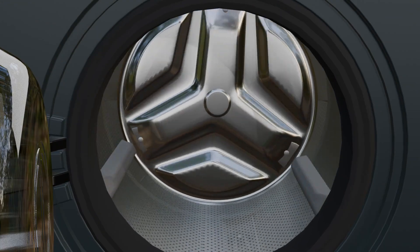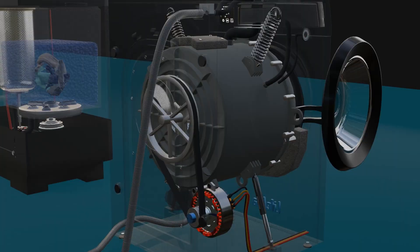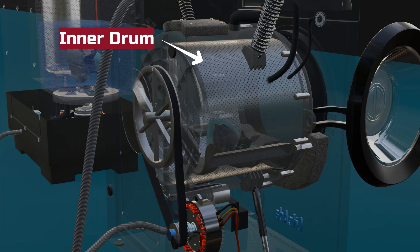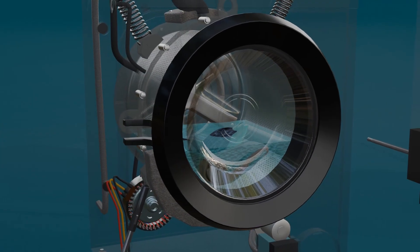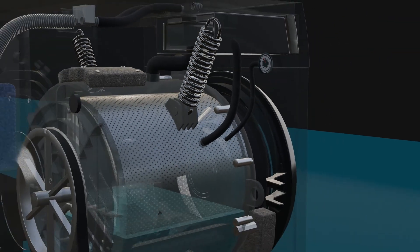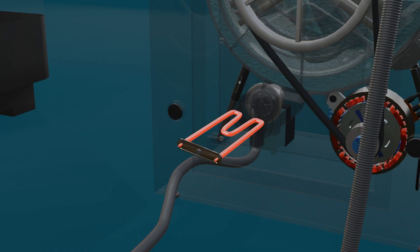In contrast, a front-load washing machine features a drum that rotates horizontally, powered by a motor mounted at the rear and connected via a pulley system. In fact, a front-load machine has two drums. The outer drum is fixed and holds water; however, water only enters it after clothes are placed inside the inner drum and the door is securely locked. Once the door is locked, the machine starts filling with water. Rather than a weighing scale, it relies on a pressure sensor: as water fills, air pressure inside the drum increases, and the sensor uses this to measure the water level. The sealed door keeps both drums completely airtight during this process. If the clothes are heavily soiled, a heating rod located beneath the outer drum is activated to warm the water and enhance cleaning performance.